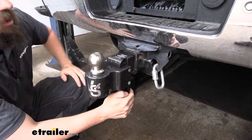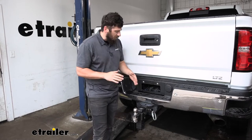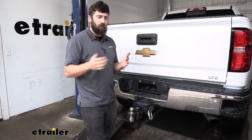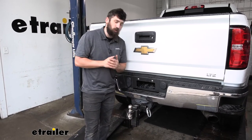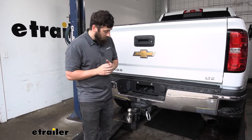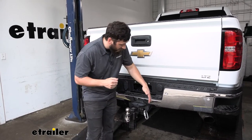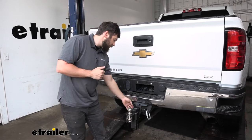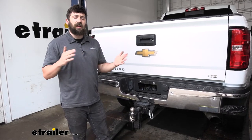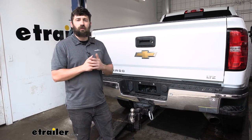You can see there it's a pretty solid connection — it's definitely going to cut down on that rattle and noise that we usually have. In addition to the anti-rattle mechanism, this also doubles as a hitch lock, because with our larger trucks using adjustable drop ball mounts, these things can definitely get expensive, so it's going to be worthwhile to protect your investment. The way these little ends are designed on this hitch pin, most standard sockets are actually not going to work — I tried and couldn't find one that worked. You're going to have to use the included tool with your kit.